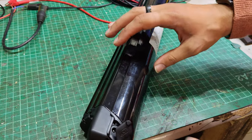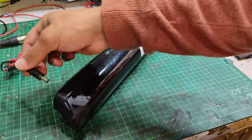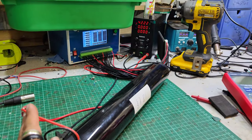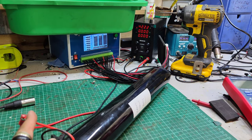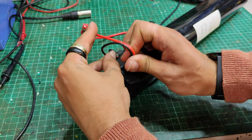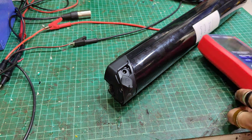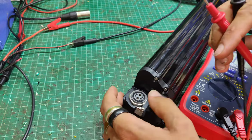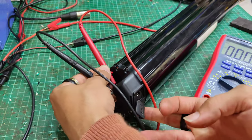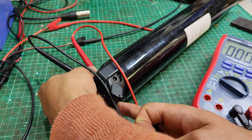There's the charge port. I've got my power supply on here. If we plug in the charger — the power supply, should I say — absolutely nothing charge-wise. Battery indicator does nothing. Seems to be loose. Not a lot going on there. We've got nothing on the output, and if we press the button, nothing.